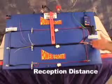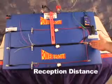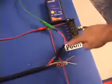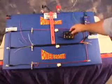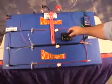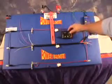It's important to understand that floating parallel wires that are capacitive coupling are weaker than the signal that is connected directly to the transmitter signal lead. You can easily detect the difference between a weaker and a stronger signal by observing the distance of the circuit and the smart receiver at the moment of detection.